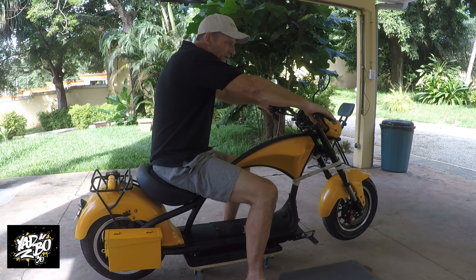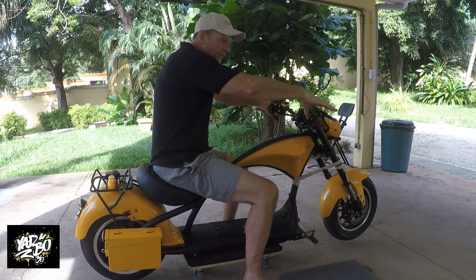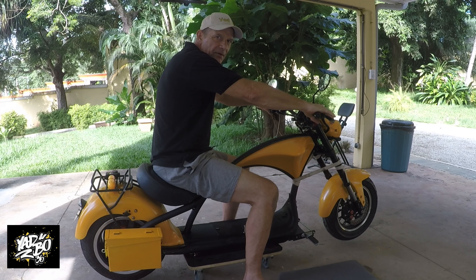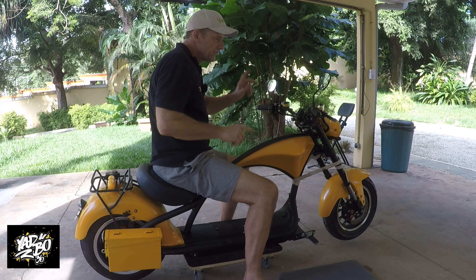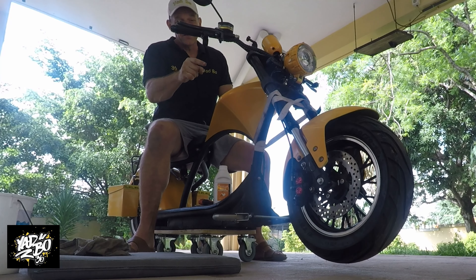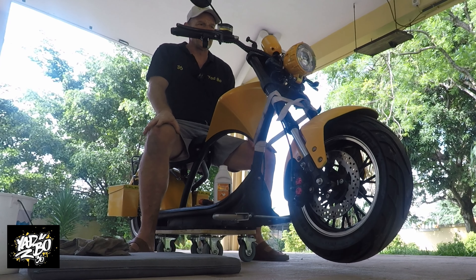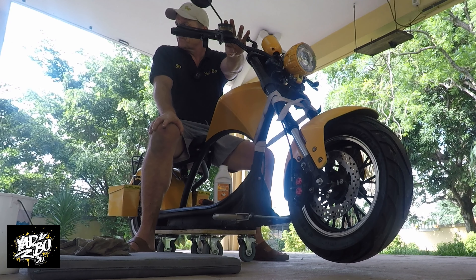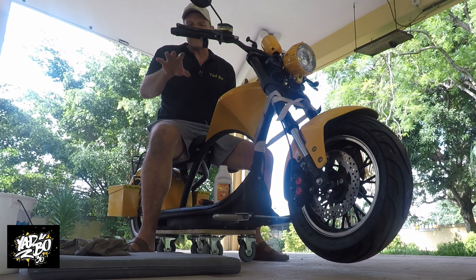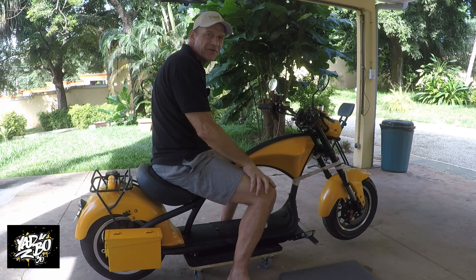My approach is: if I have to brake, I first engage the rear brake — which is, in my case, the right side — and then apply the front brake. With the rear brake I don't slip, I don't tilt. Also, secure the fork with a strap, as I did here. Because you have to open up the container, and if the fork tilts, it's going to spill the brake fluid all over the place — and if it hits the paint, it's going to mess it up.